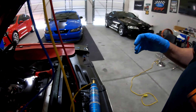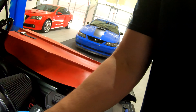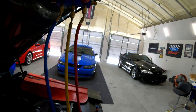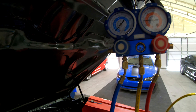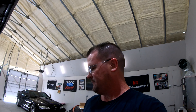The compressor kicked on — you can see it down there. When I started putting pressure I had a slight leak right here at this top fitting; I never had it cranked down tight enough, so it's tight now and no more leaks. We're getting freon in. This can is about empty — you can see where my pressures are: the high side is getting up to about 160-170, the low side is about 40. We'll keep shaking this to empty the can, and once it's empty that'll be 18 ounces of freon in it. Then we'll start adding the additional eight ounces I need.